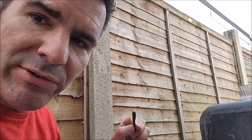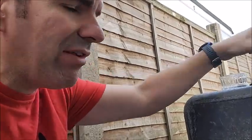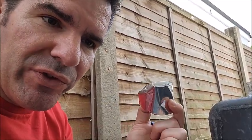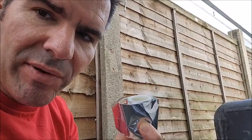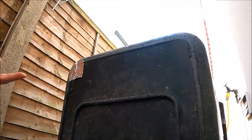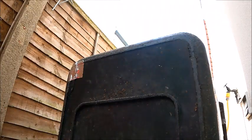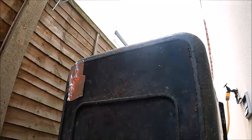I'm going to now do the inside, but I'm not going to do the inside the same way because I've got my head in that area. So what I'm going to do is use some of this tape here - much higher melting point than the plastic underneath it. I'm going to put the tape over it and then heat it on the other side. That will do two things hopefully: help fuse the other side and it will also adhere the tape - this is aluminium tape - to the inside so it's doubly secure. Actually, I've just started doing it on both sides as well. Why not? It helps keep it flat at the same time so no bits will stick out, and if it comes off it should be a better seal as a result.